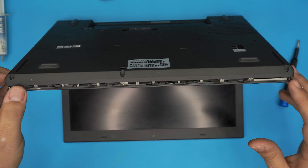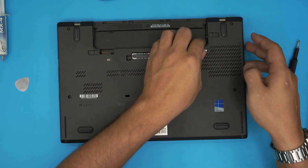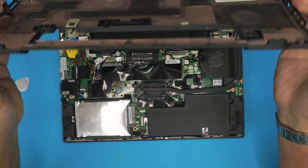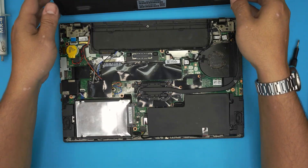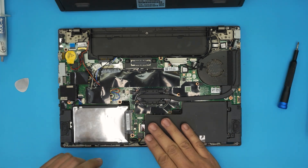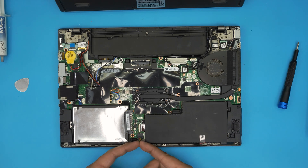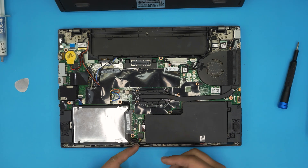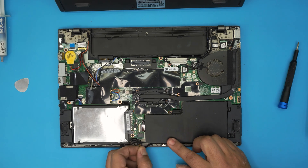Do this side as well and just wiggle around, lift it up, and move it around. Then lift up the bottom cover — and that's the bottom cover off. You can go ahead and clean up the mesh on the bottom cover. Now here's the inside. The internal battery is right over here — to remove it, pull back the jack and the battery will get disconnected. Just grab this cable and pull it backward.